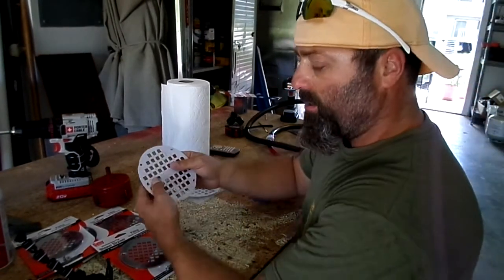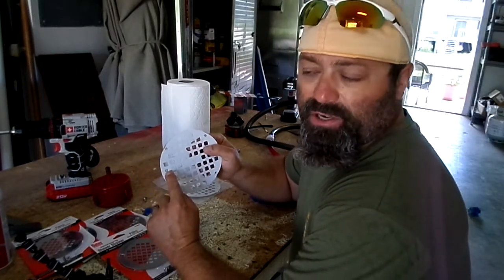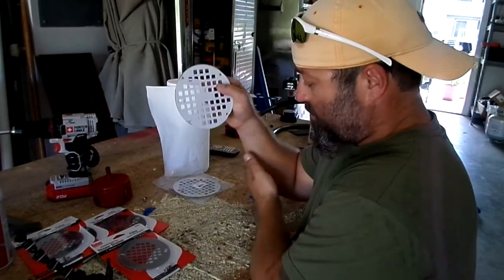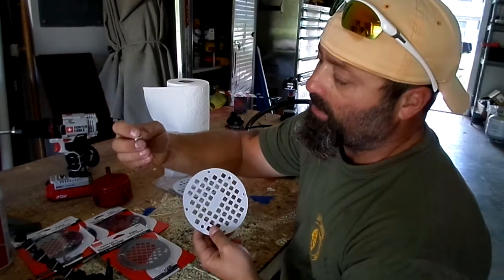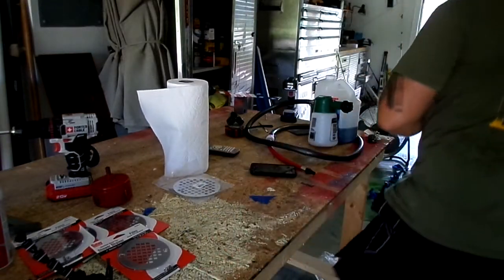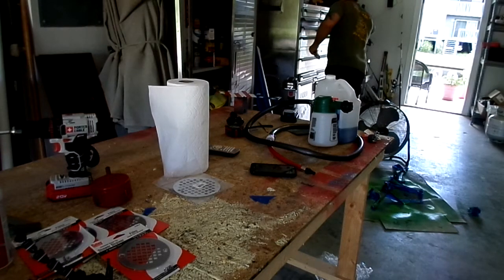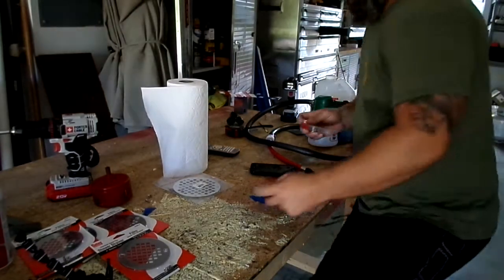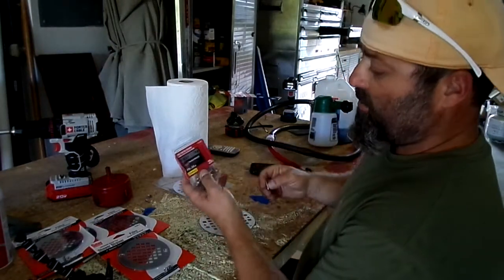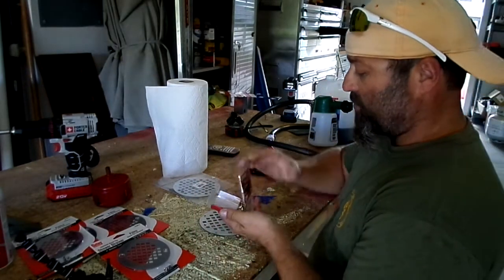You're going to need 2 drill bits. One, obviously, is about the same size as that, just a little bit smaller, because you're going to need to get some separate stainless steel screws, because these are just pre-threaded. See that? So that's not what you need. You actually need some threaded stainless steel. You grab it real quick. So these are what I use. These are stainless steel, number 10, 3/4 inch. That's all you need. It's plenty of screw.